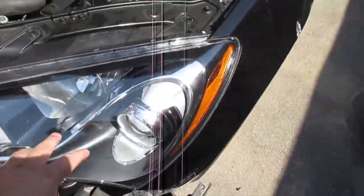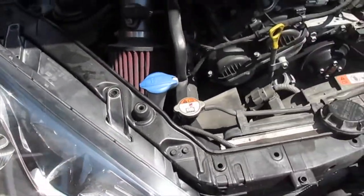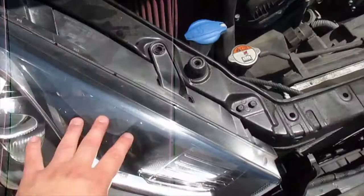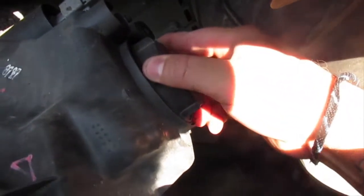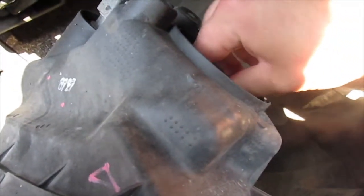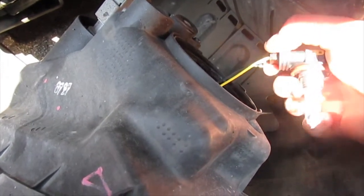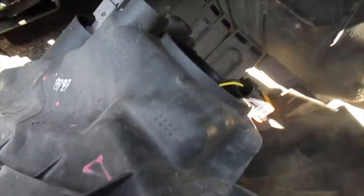After you get the headlights in — got the new one in from that side, the other one in this side — don't bolt them down yet. Have them sitting, and if you're doing the fog lights, come over here with the bumper off. This cap here is going to have the fog light in it — take off this cap, then counterclockwise, that will come right out like this. Then this tab here pulls right off from the bulb, and then put the new LED bulbs in.